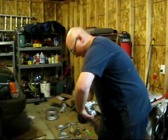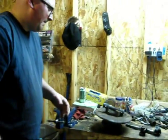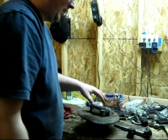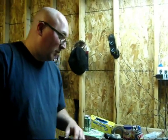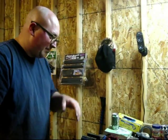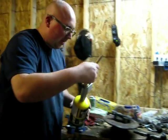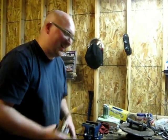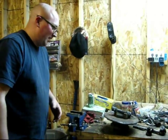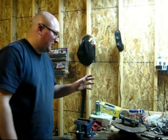And let me just set this down. Taking this stuff apart, and taking apart the kingpin turned out to be a real fun task. Pretty much everything I've taken off of here has needed a whole lot of fire to get the bolts loose. That's map gas, but I had to heat up most of the bolts red hot in order to get them to come loose.